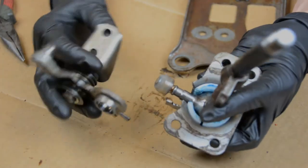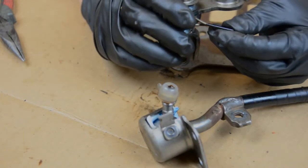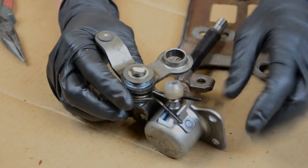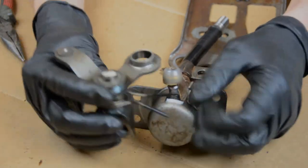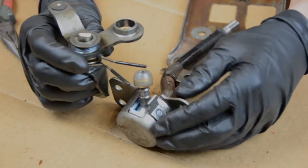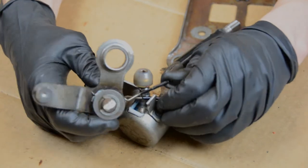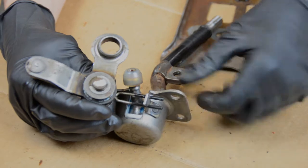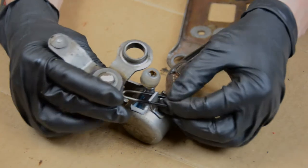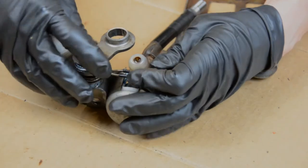One other spot you might want to grease is this assembly. The spring is a little funny. If you've ever done this to an MR2 and wondered why your car won't shift anymore or feels bad - there's this funny spring that has to go like, you see how it's scissored like this? They need to go like this across that. It gets a little bit weird because you've got to get this guy in between it all. I'm trying to think of the best way I used to be able to do this.